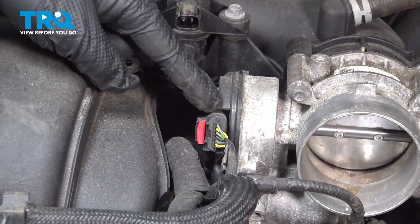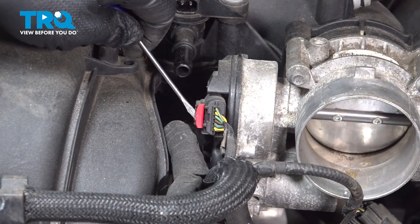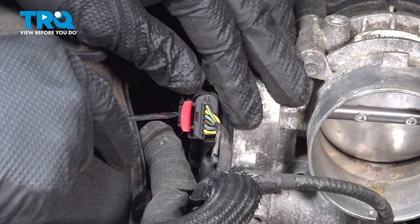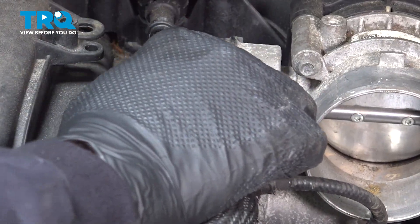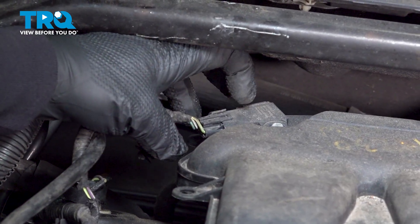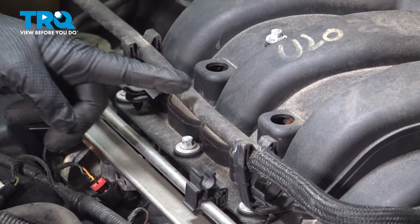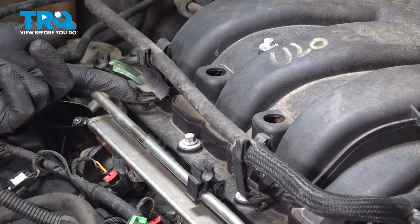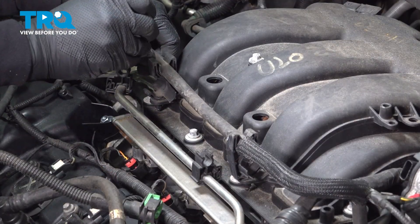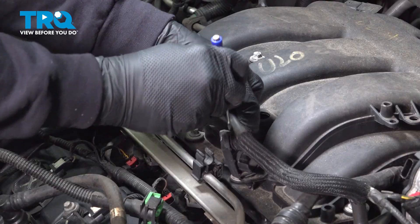Now that we have that lower hose off, transition to the connector right here. There's a red lock safety tab — you can use a pocket screwdriver or your finger to lift that up to a certain point where it stops. Then there's a tab you push in. Use your thumb, pinch and pull this off. On the back passenger side of the intake, find the map sensor — lift up on the little tab and gently slide that connector off. Across the front of the intake, we have a coolant tube. Use your pocket screwdriver to open up the little tabs and simply roll the hose out on both sides — that way you don't risk breaking the plastic.